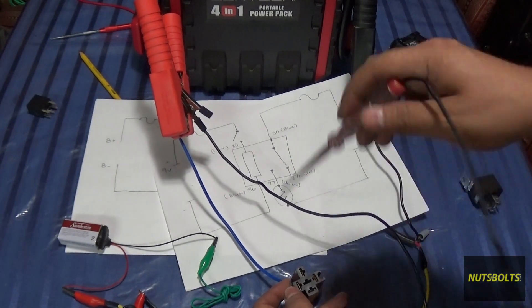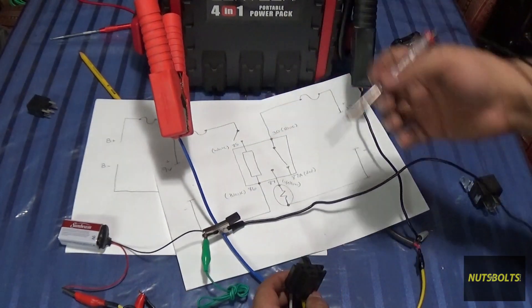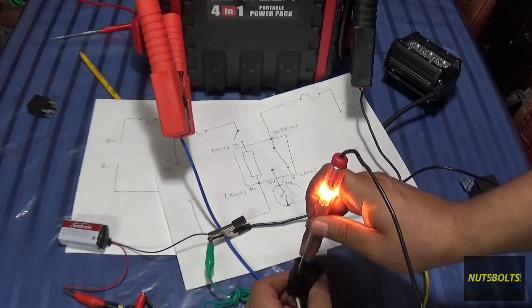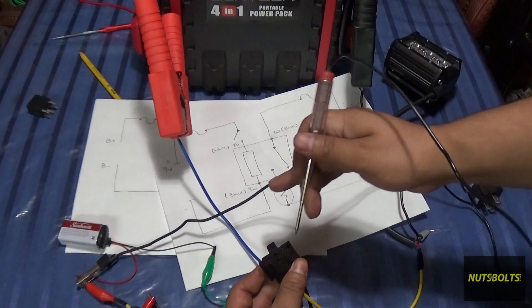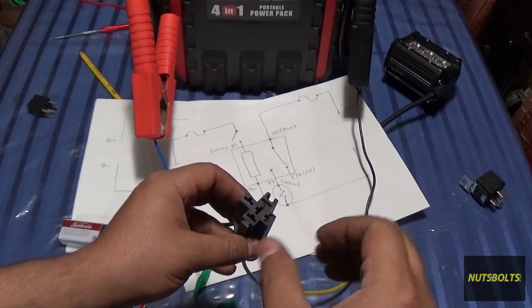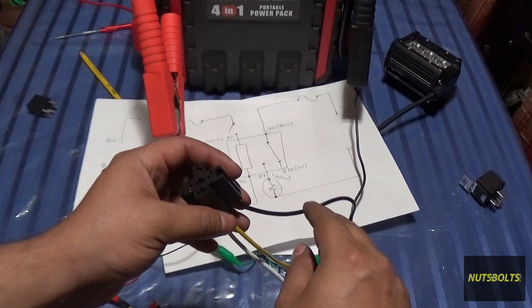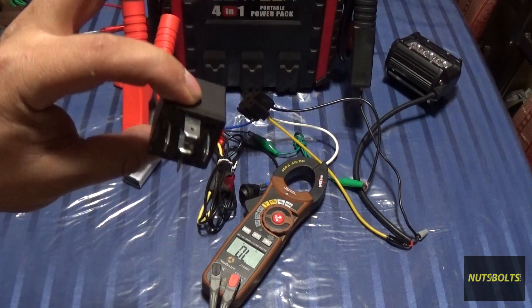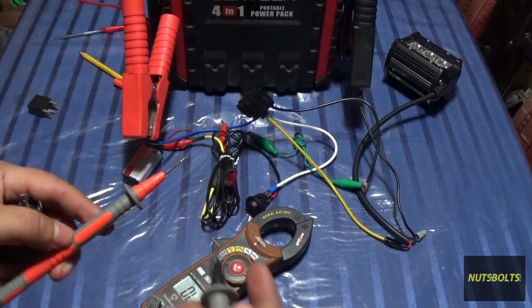You could also jump a wire from that end once the load side checks out. Then check the control side — place the ground on the control pin and verify it's giving power. To check the ground for that side of the circuit, plug onto the power pin and probe the ground. Make sure the test light lights up nice and bright, especially when checking grounds — if it's dim, you may have corrosion on the ground side and may need to clean the frame ground.